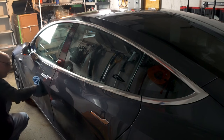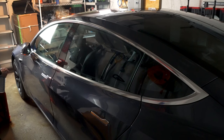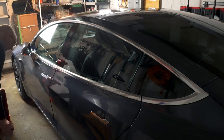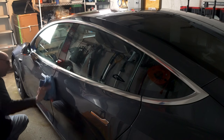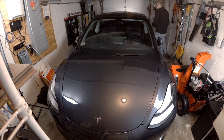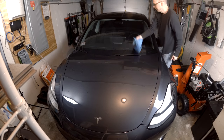I've done this with my previous car and my Model 3 quite a few times and haven't had any scratches. If the surface looks clear, then you can do an even lighter spritz — barely anything. Refold the cloth to get a clean quarter and then wipe along the surface again. This time you can apply some light pressure. This is essentially the final buffing of the section. And you repeat this process section by section, ending with the wheels.